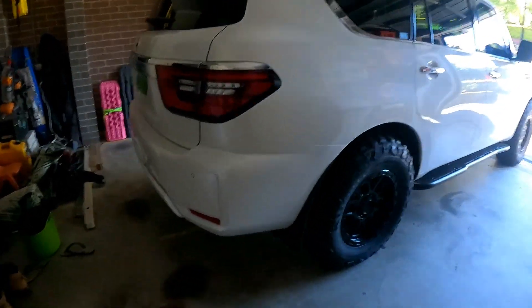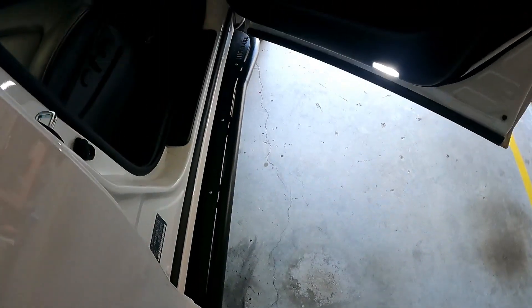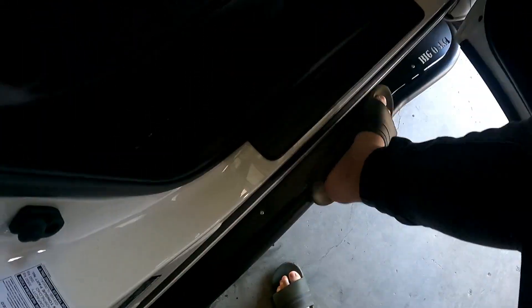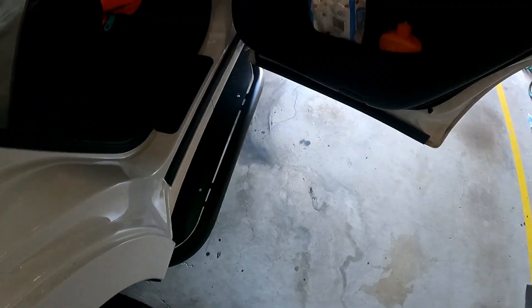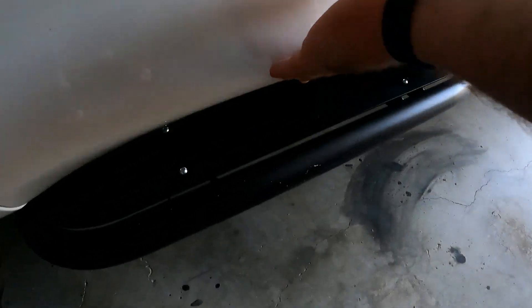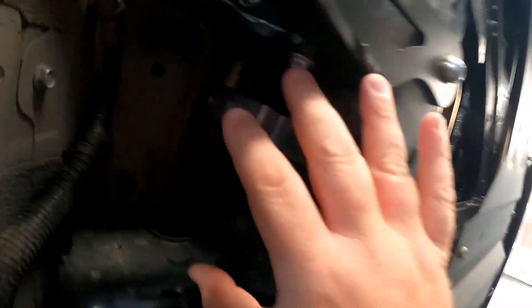That is a sexy slider. It's been a few days now since we installed these. When you look down the side of the car, it looks like you've only got a tube bar, but with the design of the Nissan sills you've actually got a little bit of step. Quite easy to stand on, even at the narrowest section — you don't feel like you're going to slip off. With the kick-out, it gives you more step, and because of the way the door goes down, you can still quite easily stand on it with the door closed. I'd say allow yourself five to six hours to do this job. On the passenger side where the U brackets go above the chassis and you've got brake lines, you need two little lengths of hose — make sure you've got the hose first. Where the front bracket bolts through the body mount, you don't have a lot of space, so you will need a 45-degree drill. And at the back mount, use the dental floss trick. Other than that, I think they're a great thing.